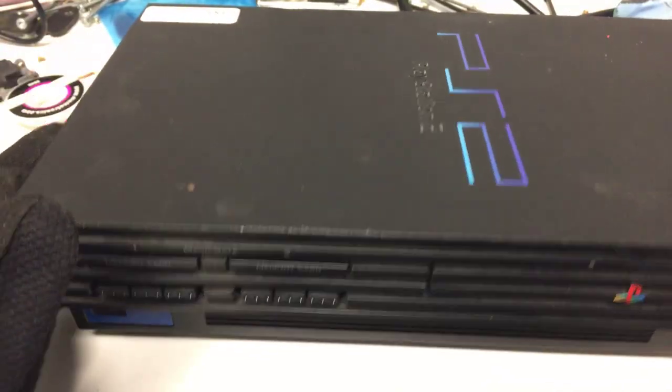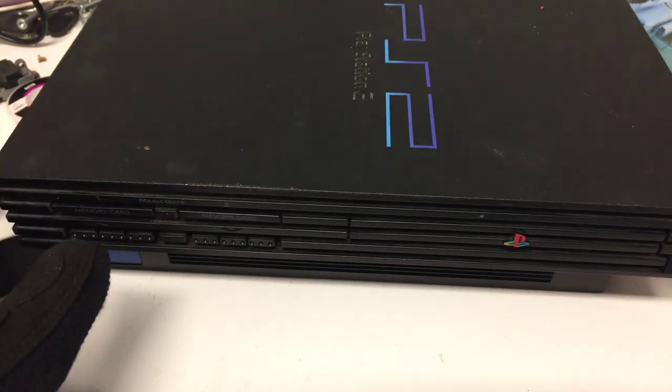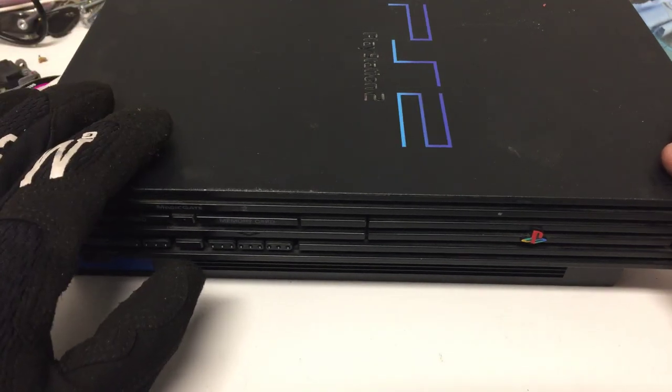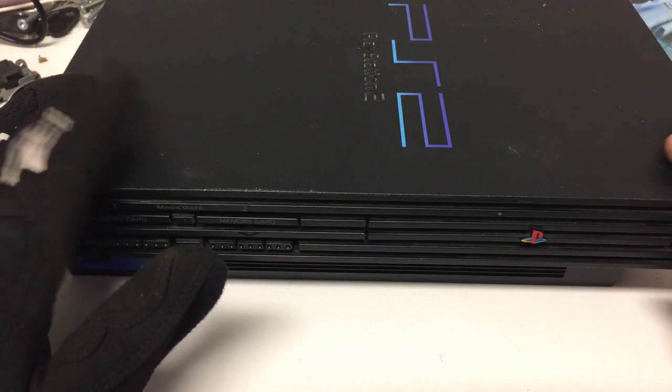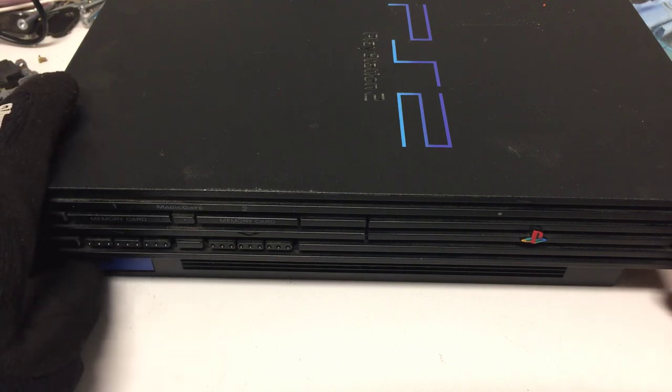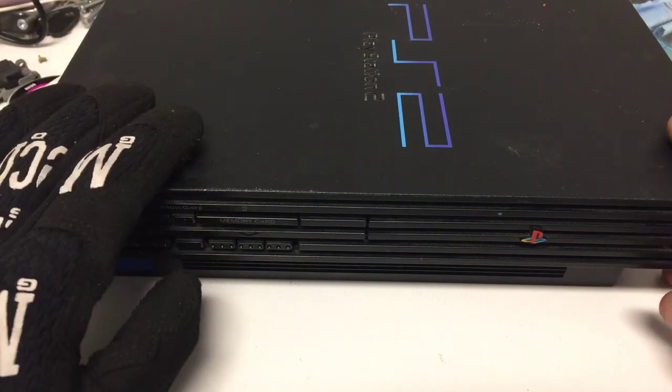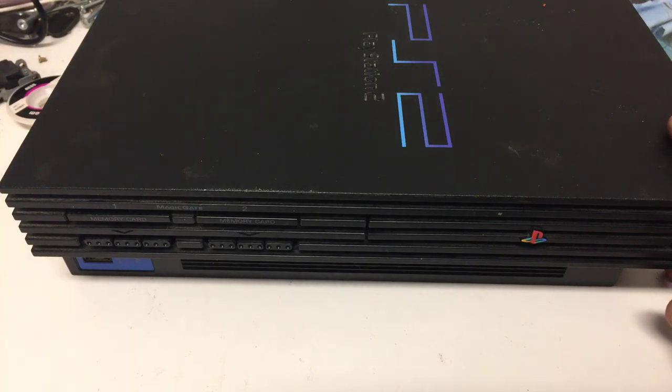But there you have it — that's a laser replacement for PS2 fat. So if you found this video helpful, like and comment if you'd like, subscribe if you want. Hopefully this helps you out for your PS2 fat and you won't have any issues anymore. Most commonly, blue discs don't get read, but also PS1 discs won't read when you need a laser replacement. I would also recommend getting your discs refurbished before you go about putting a new laser in — just do that with disc repair services. If you do need a laser replacement though, by all means go ahead and do it. But that's how you replace a PS2 fat laser — thanks for watching, and have a great day.